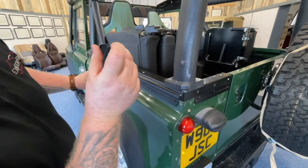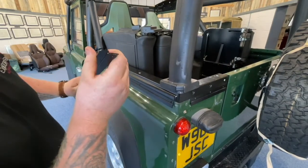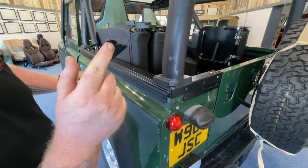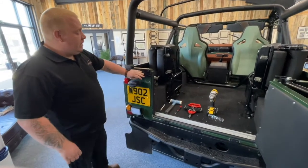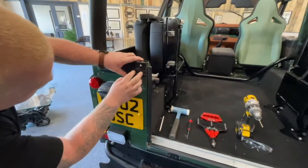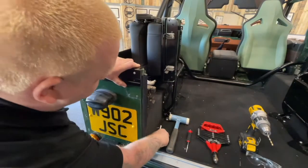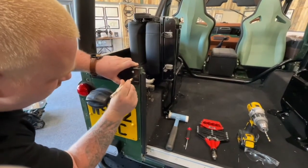A little more about the Z channel: it is shaped and comes with the holes already pre-drilled. The holes go towards the top of the vehicle and your hood will tuck in under the small lip. Get the Z channels roughly where you want them, tucked up neatly along the edge and the body capping. When you're happy, mark it with your pencil so you know where you're going.